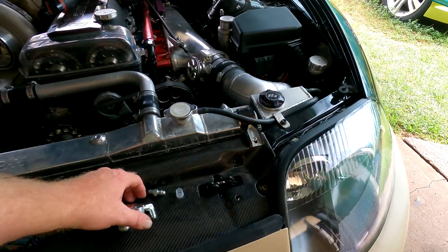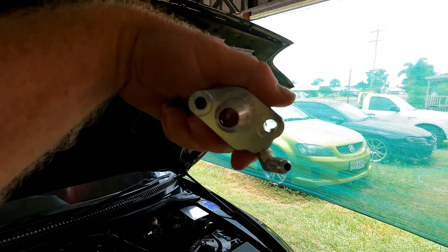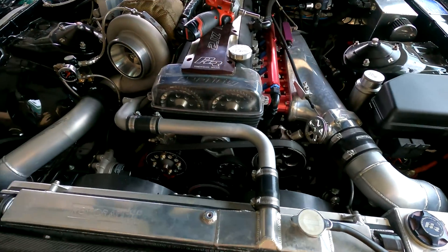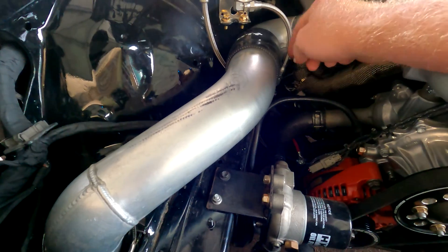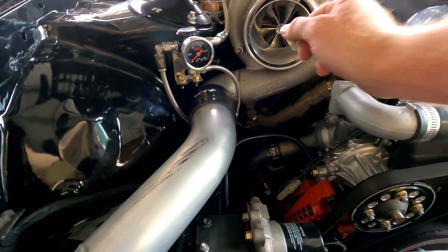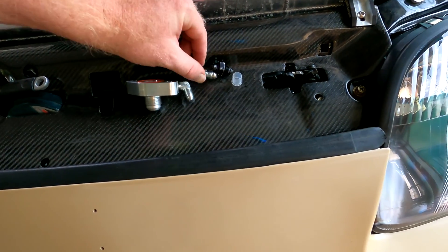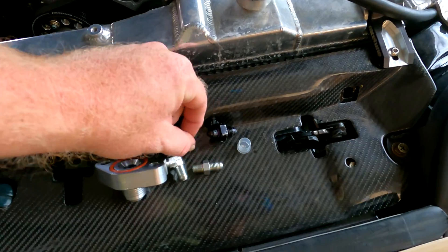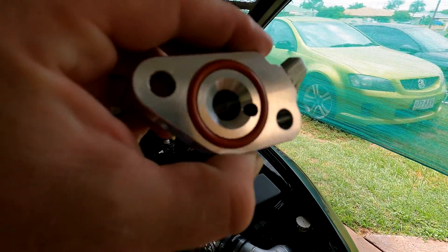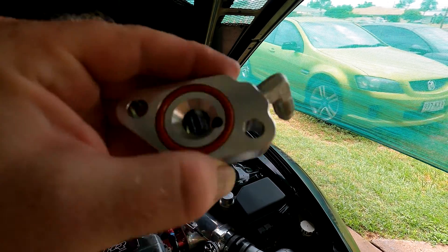And hey, that works. So I went and did the same with this one. It's a 90-degree. Once it's on the block it'll be like that. We're gonna throw it up to my drain, because I'm thinking the drain was a little held back. It was actually making the OPR not work properly. I'm gonna try this anyway. The 90-degree is drilled at 5mm. The Drift Motion flange is 5mm — the return hole anyway.